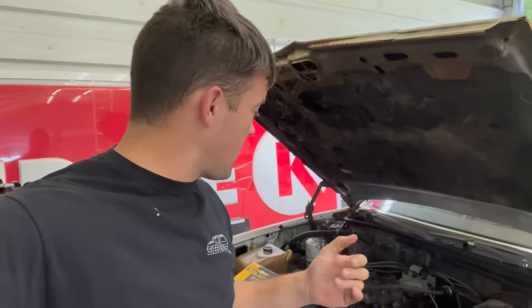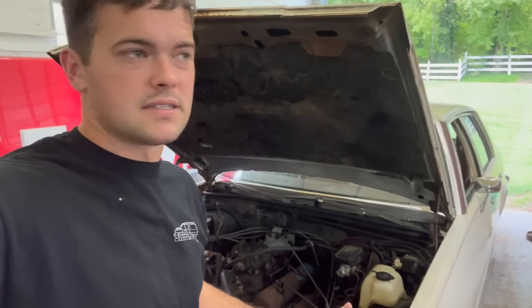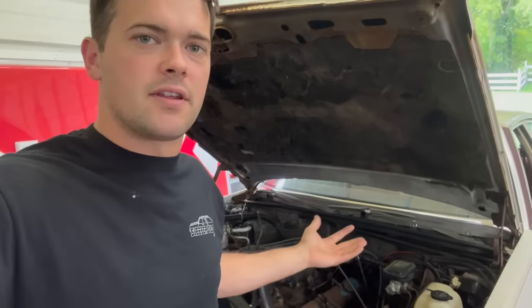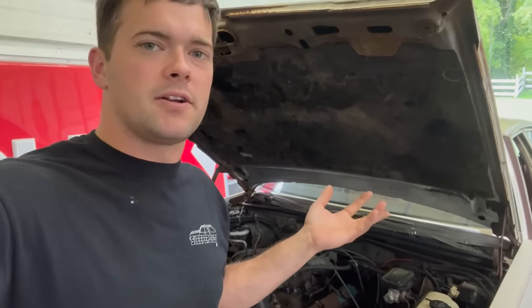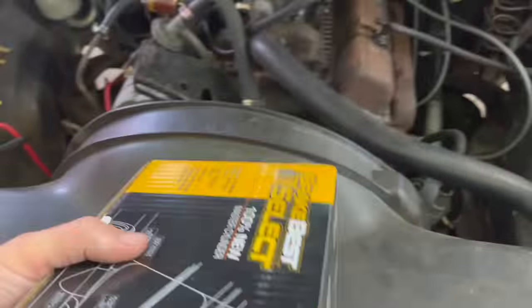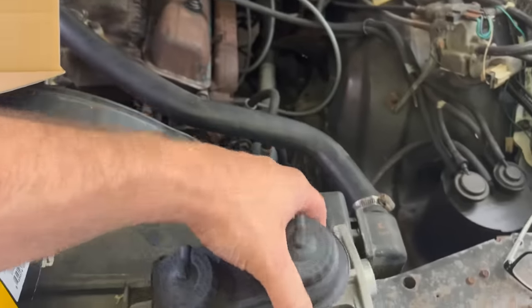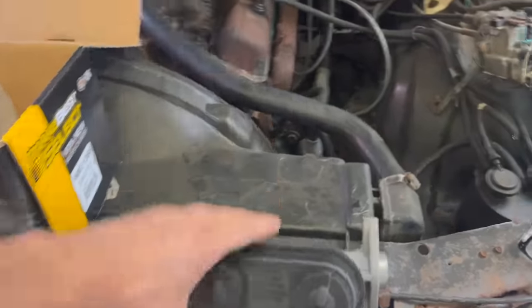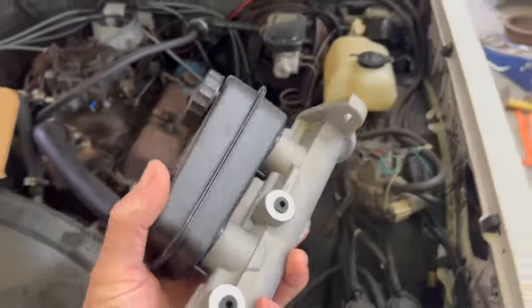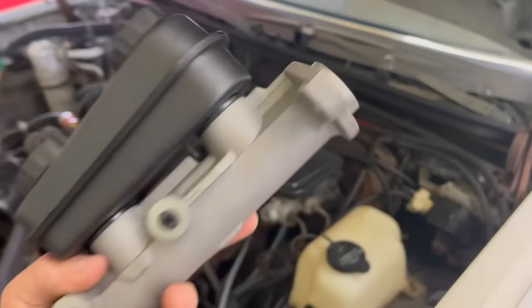It's the next day now, and I'm back out here working on this thing. Pretty sure we're just going to go with manual brakes. We're going to try to convert this thing from power brakes over to manual brakes using a Crossford Town and Country master cylinder. If you've watched the channel for a while, you know we put this on the '67 Thunderbird, the old LTD wagon, and the F100 truck. These things are aluminum, lightweight, compact, cheap, and they work. So we're going to try this.